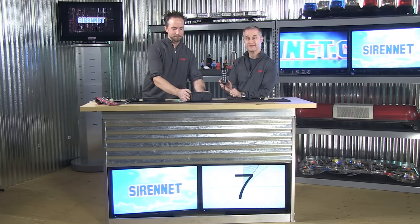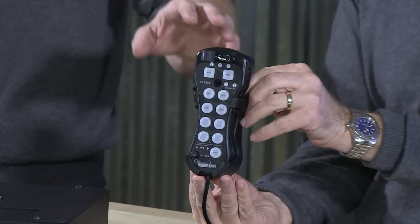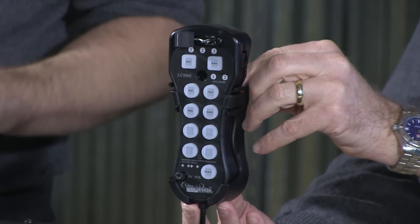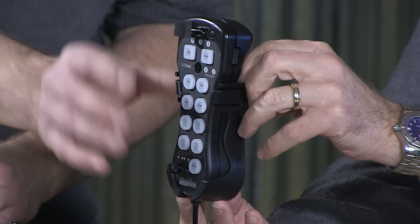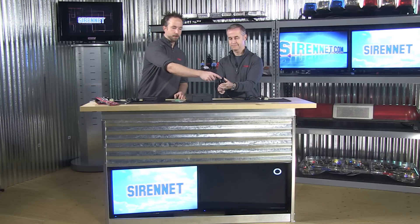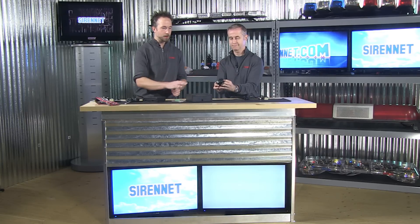So here we have the control head. We have an inclusive siren and lighting controller. It is based on a handheld control head, which allows the use for siren tones. It's actually a 200-watt system, so you can power two 100-watt speakers with it. It gives you a built-in PA, so this is not only your controller but your microphone as well. It has a nice heavy-duty slide switch on the top, so for folks that are actually wanting a true slider, this will go ahead and offer that for you. It also has push buttons for siren tone activation.